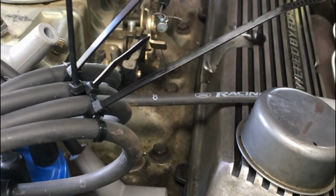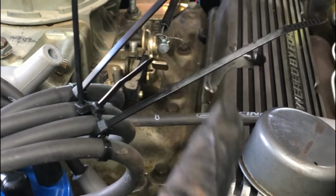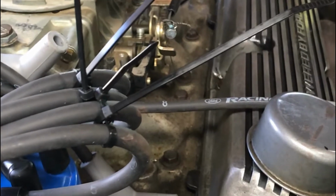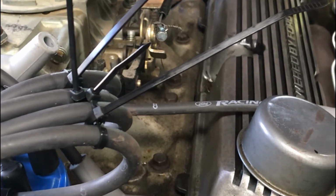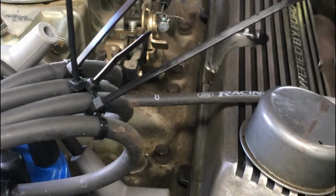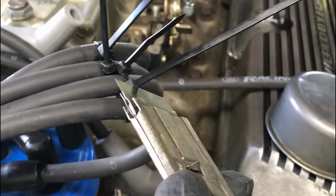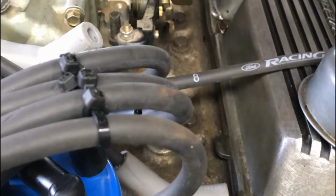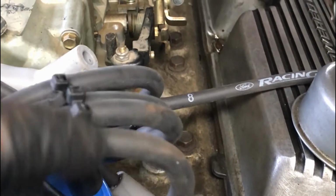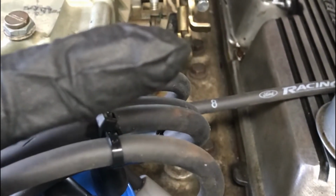Now that you have your nice neat tie wraps and your wires wrapped, you got all these unsightly tails kicking around, and we want to get rid of them. Most people will just take their side cutters and cut them off. Unfortunately, this leaves a bit of a sharp edge, and it looks like you just tried to pet a Wolverine when you're working there in the future. What I like to do is get the old trusty straight razor and give it a trim. You gotta kind of hold on to the tail, but you'll find that it leaves a nice smooth cut. Okay, here we go. We've got all the tails trimmed, and as you can see, I can rub the old plastic glove over it, and it didn't even tear, which normally tears when you look at it wrong.